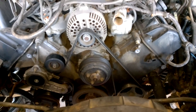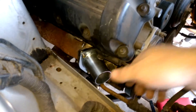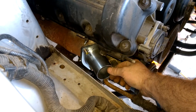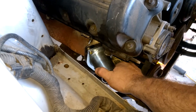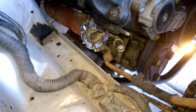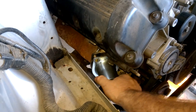Okay, what is up — here is an update. There's the passenger side manifold, temporarily bolted back on, and right there this will be my joint that comes apart. I used a header flange that I welded to the manifold. The flange is a little bigger than the outlet on that, so I just had to fill it in and weld it up. It can't leak — it's welded on both sides, so that's good.